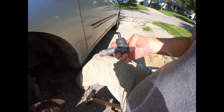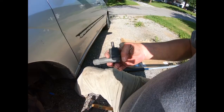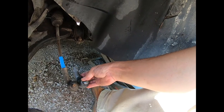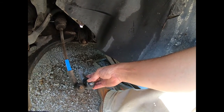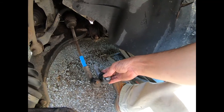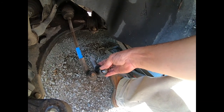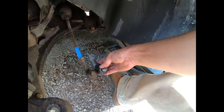Check this out — I broke out the new part. Pretty, ain't it? And we look at the old one and compare them side by side. From the center of the pin to the shoulders, they're the same length. So I should be able to undo that one and spin this new one in all the way until I get to the edge of the blue tape. That should be good.